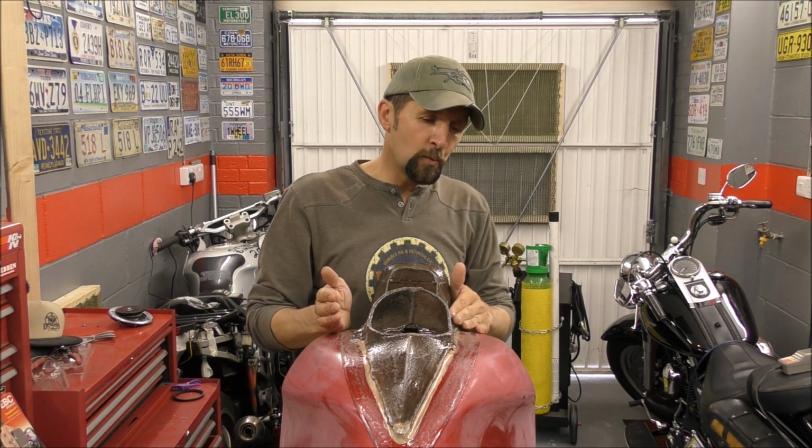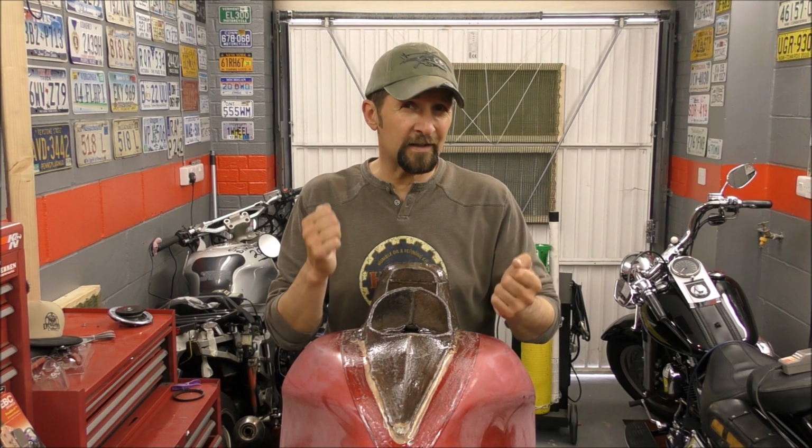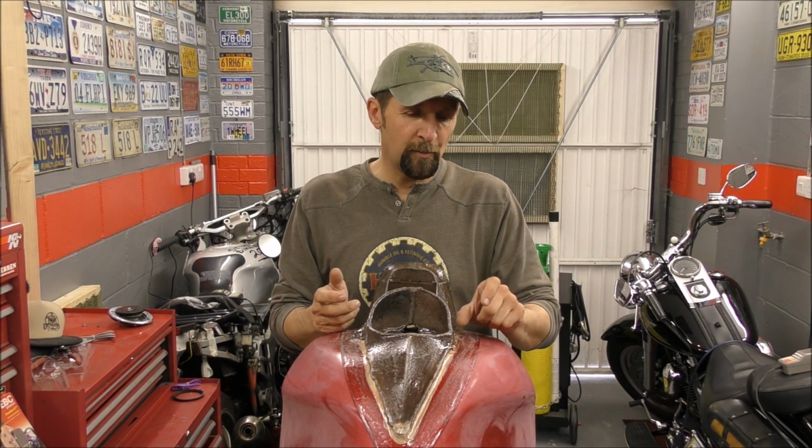Now, naturally the first thing you think is just whack a load of filler in there and blend it in, or mould it, as is the proper term. But filler is a bit funny. I'm using P38 plastic padding, which is effectively a flexible filler, but it's only flexible if it's thin enough. If it becomes more than about half an inch thick, that flexibility is compromised and it can crack. And also, right along this area here, it's not going to flex much. It's just that who wants to put an inch of filler all the way along? I think it's just a bit crap, really.